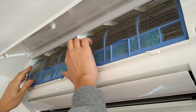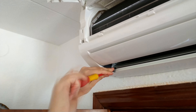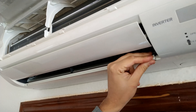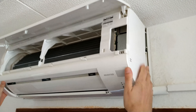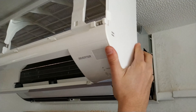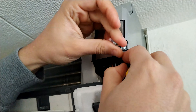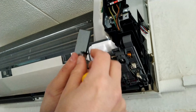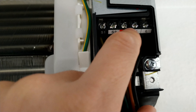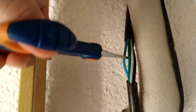The first thing we have to do is find the power cables. To do that we have to open the cover, remove the filters, and then take apart the air conditioner chassis. It's possible that you have to dismantle more parts to find the cables. We need to find a place between the air conditioner and the circuit breaker to install the smart switch. In my case they used blue for the neutral and black for the line.